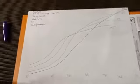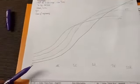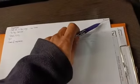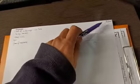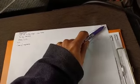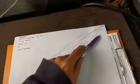And then I've got one last purple curve here, which illustrates a bad trade-off and a bad camshaft choice, where I've called this cam, say, 310, very big for this engine. In that case, you can see we've given away lots and lots of power only to make this tiny amount of extra power up top compared to, say, our 290. If we look at the curve again, try to ignore the other lines, but this cam crosses over at about 7,500, 8,000 RPM. And then at 9,000 there, I haven't even peaked yet. It's at 310 degrees, and it's still going up in the rev range.